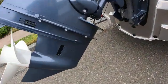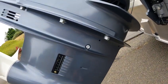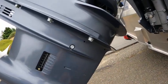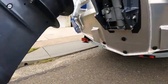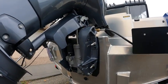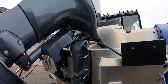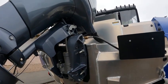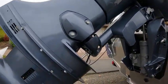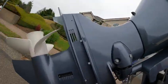Gear case oil — here's how you check it. Just take a zip tie, make sure the motor is straight up and down, put it in there. It can be down like a quarter inch to half inch — that's okay. There's your trim pump, there's your motor stops. We recommend using the wedge instead of using those, because Yamaha doesn't cover those, and they don't cover water pumps and fuel issues either.